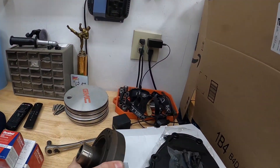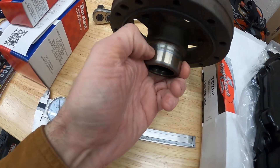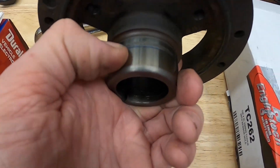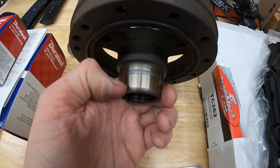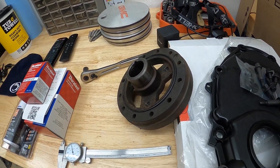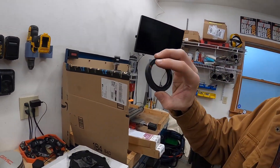The only thing I can think of is that my damper has some wear. You can't even catch a fingernail on it, but you can obviously see there is some kind of wear happening from the seal. This is the stock damper, so I'm hoping I'll be able to fix this with my new ATI damper, which I dropped off at the machine shop a couple days ago to get a little more machining done — so that it would not hit the front lip on the seal. Hopefully I'll be able to run my aftermarket damper, switch back to the individual ignition coils, and run it like that.